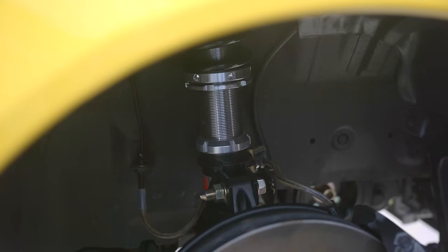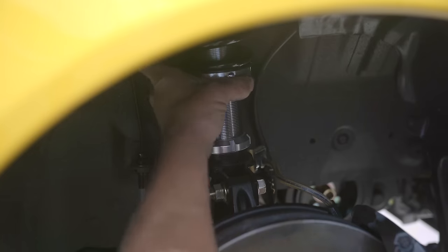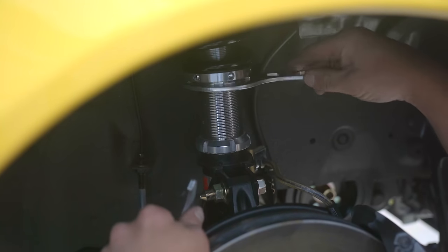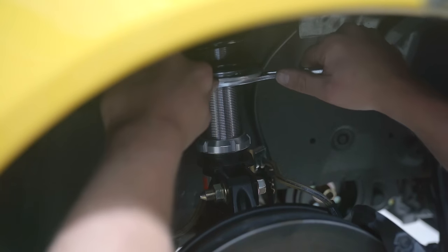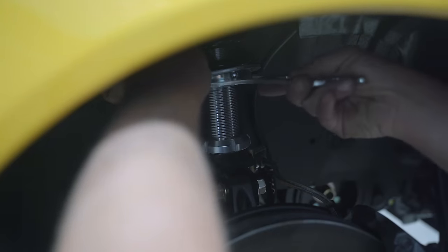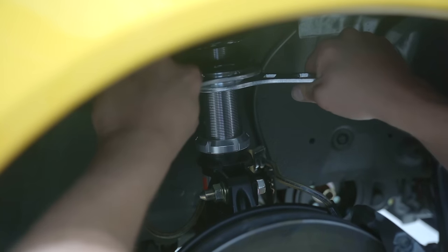Brakes are all bled out, axle nuts torqued. Axle nut cotter pins installed. I was going to potentially lower the car down a little bit, but I don't think I'm gonna do that. It's at a pretty good height right now, and I don't wanna mess with it. I don't want tires rubbing on fenders. I don't want it super stiff. If it's lower, I gotta stiffen the coils. So let's just lock them in place how they are.